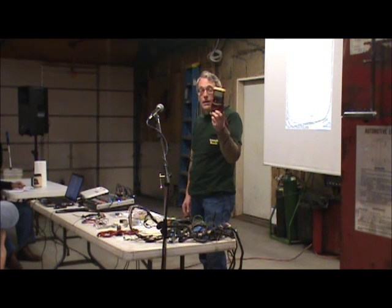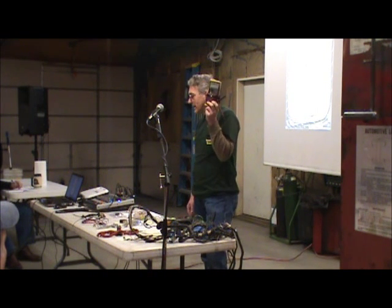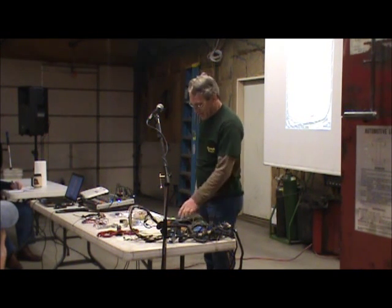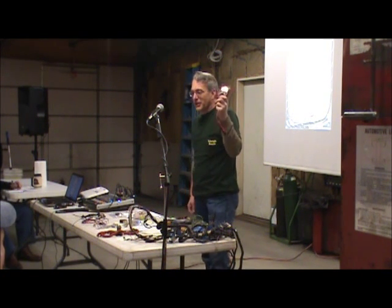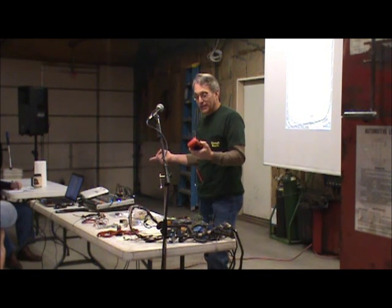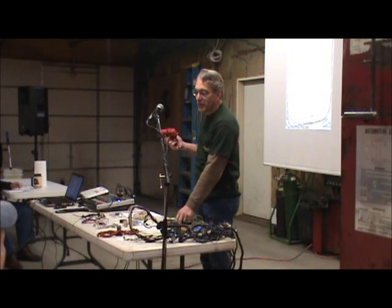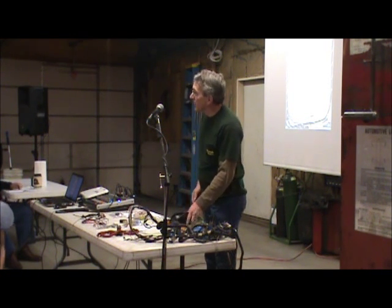This is a Fluke 77. They don't make the 77 anymore, and a Fluke meter starts at about $300. You don't have to spend that kind of money. Sears to the rescue. That's like $50. It'll tell you all the same information. And you basically only need, for an automobile, DC current and voltage and resistance. Anything beyond that is just extraneous information, it just makes it more useful for other things. It's good to have one with an audible beep, though.